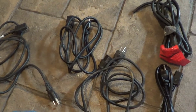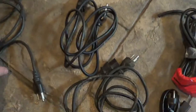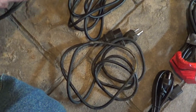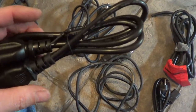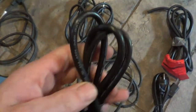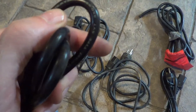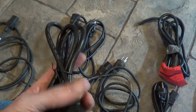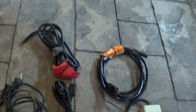I could go to the store and buy a cord, but I've got tons and tons of cords — lots of computer power supply cords. The only thing I'm a little leery of is most of the ones I've got are only 18 gauge, and I'm thinking that's a little on the light side for a toaster that draws over a thousand watts. I'd like to be at least 16 gauge.